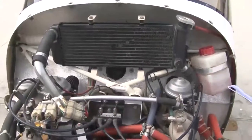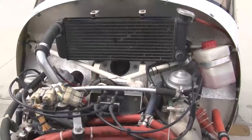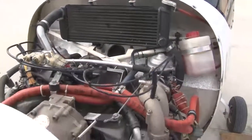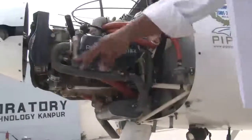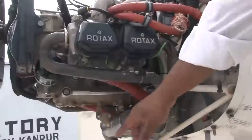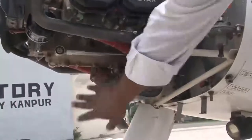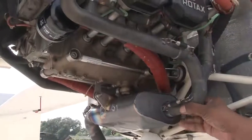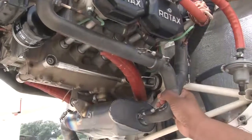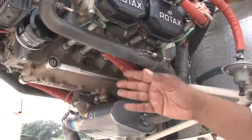Check that the exhaust pipes and collectors are firmly in position with no cracks, springs intact and in position, and rubber dampers intact. You can see the exhaust system here — the exhaust pipes are all securely attached. You can see the springs are securely attached. Everything is intact — I can look for all adjacent areas plus the security of attachment. My exhaust system is proper. Similar inspection has to be done on the right side as well.